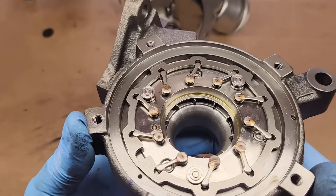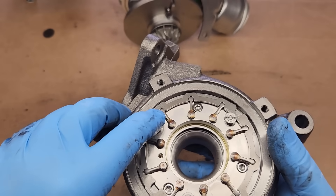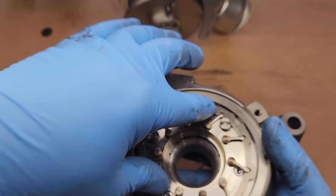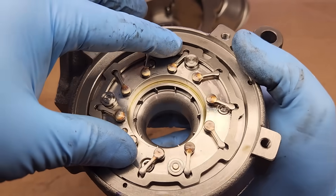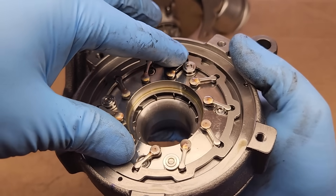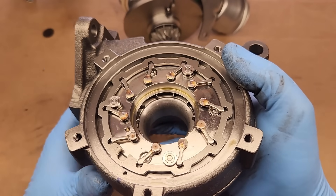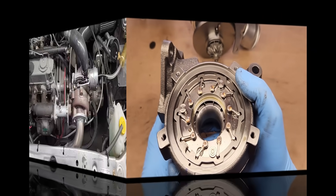At least that's the theory. But the downside is the variable nozzles will also increase the back pressure between the engine and the turbocharger. Today we want to find out how much back pressure this turbo is creating, and what would happen if we modify the factory calibration for the VNT linkage — will this create so much back pressure that it'll choke the exhaust stream from the engine and possibly cause us to lose power? Or will it allow the turbo to spool up even faster and create the low-end boost that we're looking for?